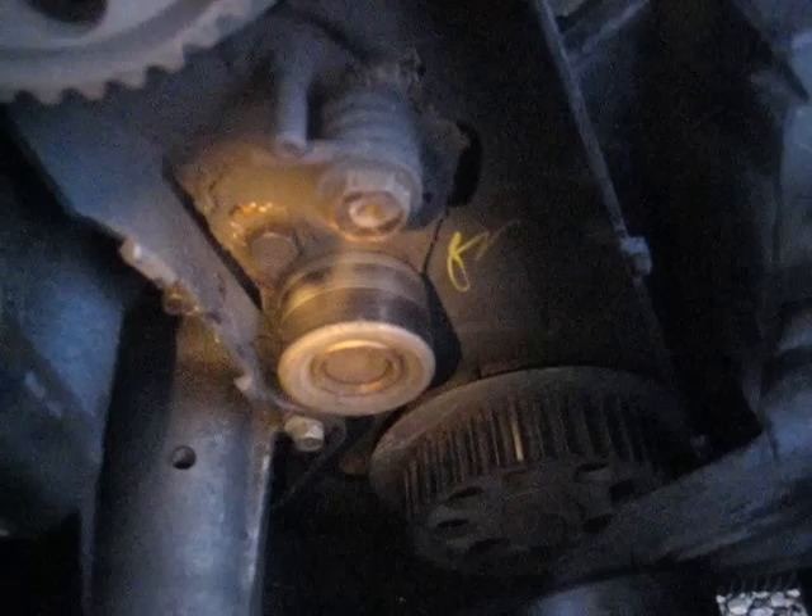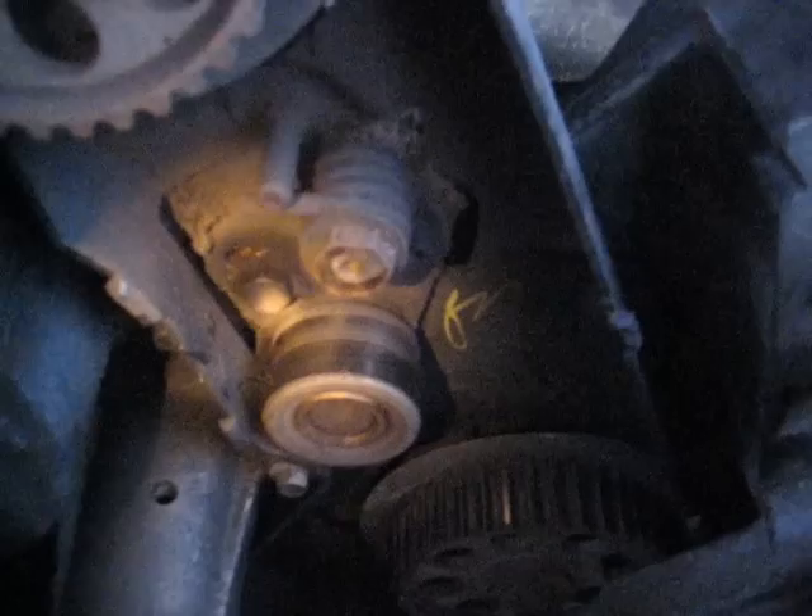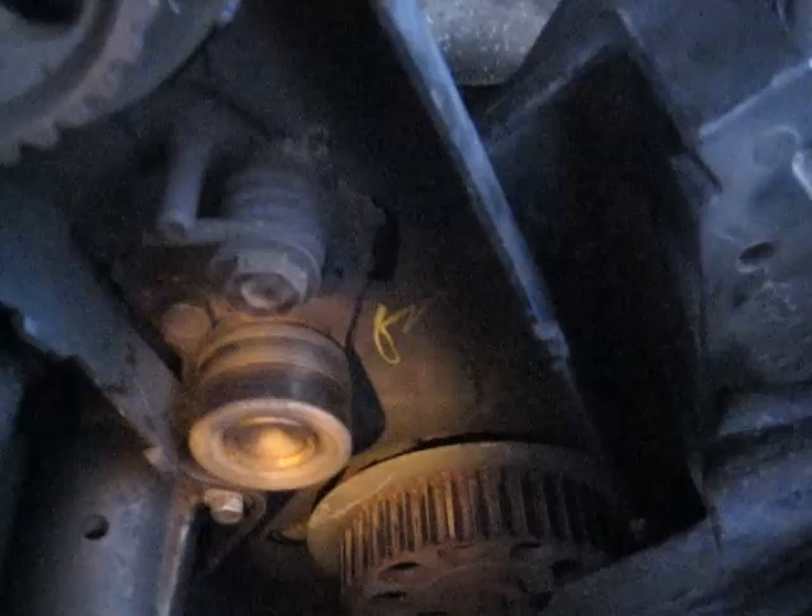Now that we've got our keyway straight up, we've got our timing marks where they need to be according to specifications. That's the bolt I was telling you about earlier that you can use to hold that tensioner in the loose position. When we go to put the belt on, we're going to loosen that up, that spring is going to pop back out and tighten that belt back up. You want to make sure everything's dead on when you do it - if you're off even one tooth, you're going to have performance issues. Because of having to use the puller, I removed the radiator.